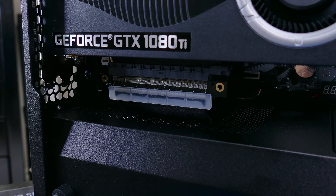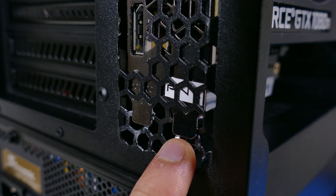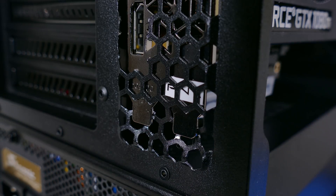When you have the card lined up roughly where you think it's going to be, I suggest cutting out two slots in the back grill that will work for those little metal feet on the back of the graphics card. Cut out just enough room for those legs to squeeze through — that's really all you need to do at the base of the grill.